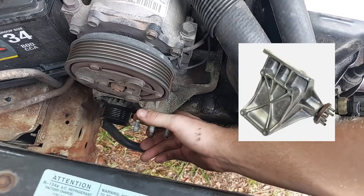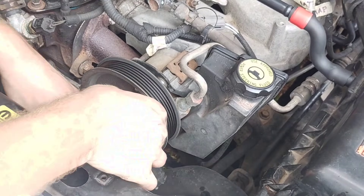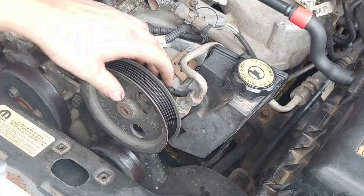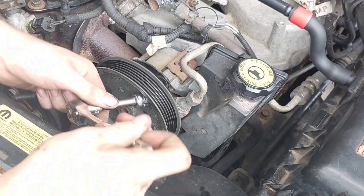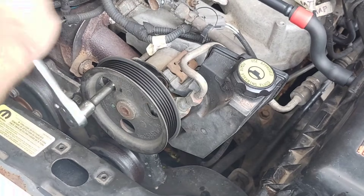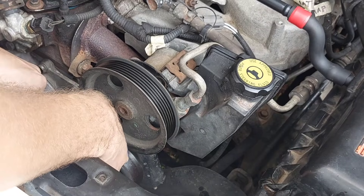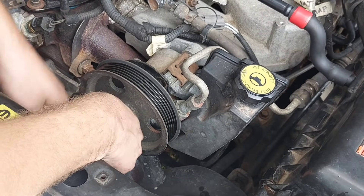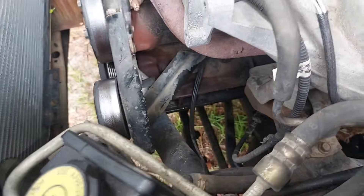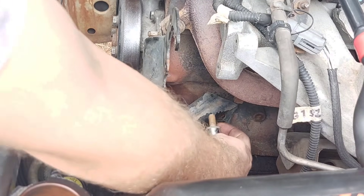If the bearing is bad, you'll have to find an AC compressor bracket to replace it. On the other side, let's get the power steering pump out of the way. You don't need to remove it, but replacing the water pump is a pain with it still attached. The power steering pump bolts to the belt tensioner, which bolts to the water pump, so leaving it in there just means something else in your way. The belt tensioner has a 9/16 bolt on the engine block reached with some unique maneuvering, and then two more attaching it directly to the water pump.